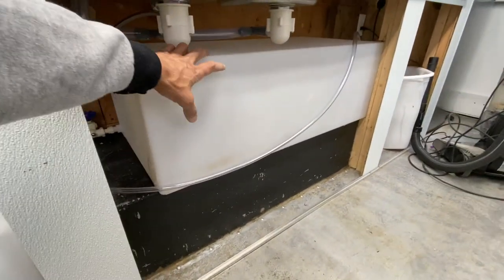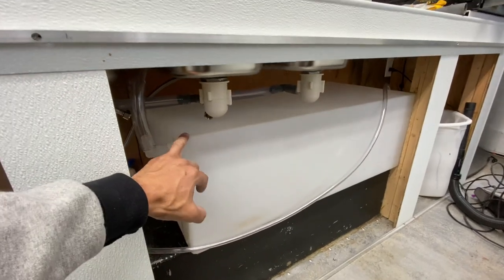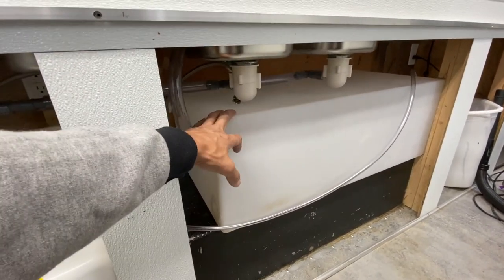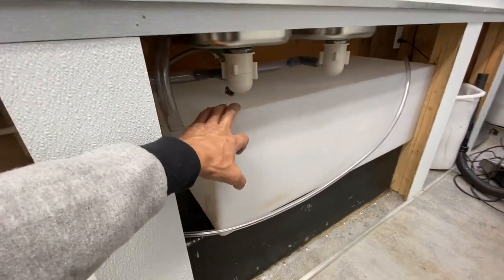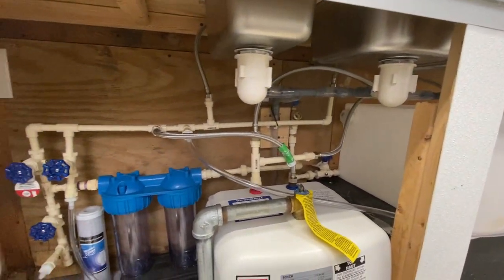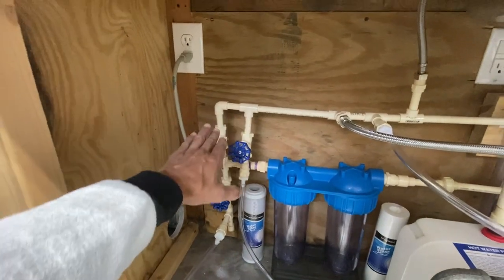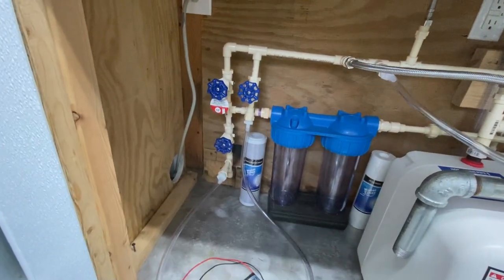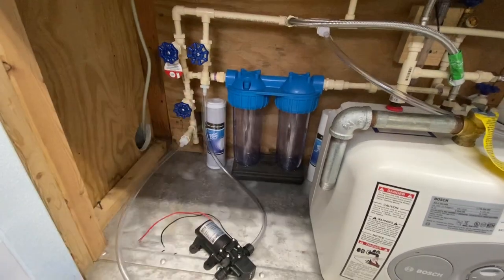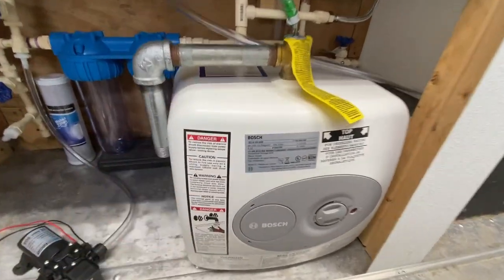At this point you should already have your fresh water tank. This is a 30-gallon fresh water tank; below is a 42-gallon gray water tank for waste. You need 10 gallons or more for your gray water tank because of ice that may melt or anything else poured in. Here's a mock-up — nothing is glued yet, no primer or cement. That's my little battery-operated electric water pump.